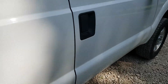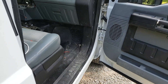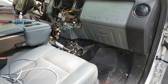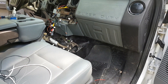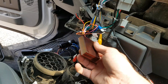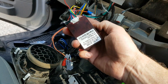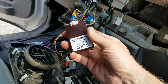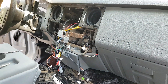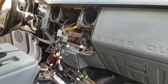Working on the 2011 F-250 — this applies to all 2011 through 2016 F-250, F-350, etc. Let's say you're installing an aftermarket radio, maybe a Chinese brand head unit that comes with a CAN adapter. Something like this doesn't output the correct retained accessory power. It doesn't have the delay when you open your door. So we have to find a source of power that maintains that delay so your stereo stays on until you open the door.